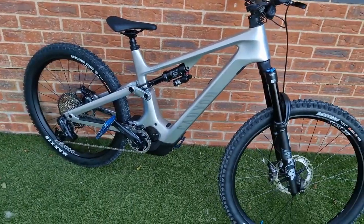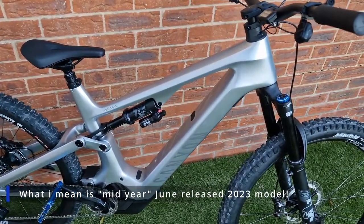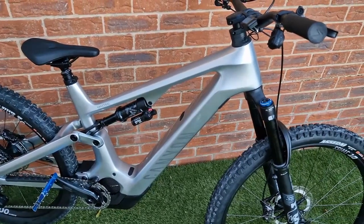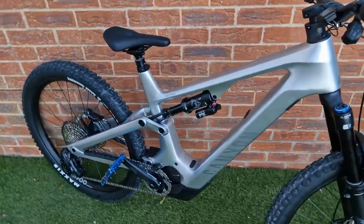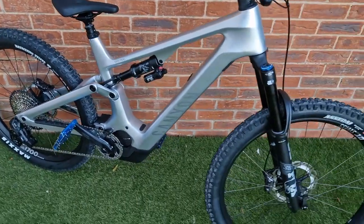This is what I call a mid-season revamp. This bike has won quite a few awards for a direct-to-consumer brand. A lot of the negatives — the cons — were the Fox 36 forks. The fact it had 150mm at the front and 155mm at the rear was a very weird balance, having less travel at the front than the rear.